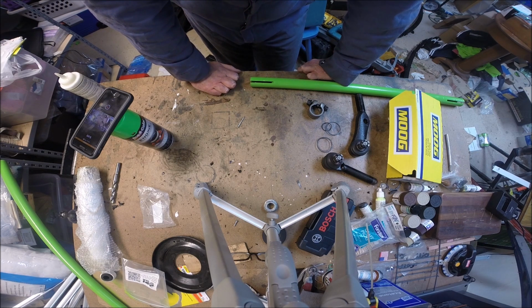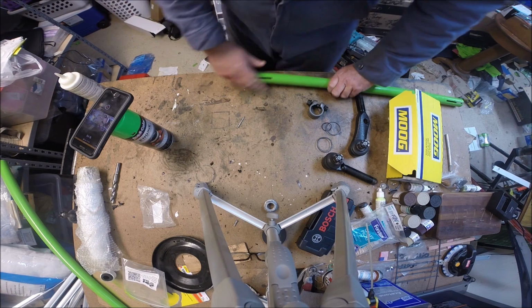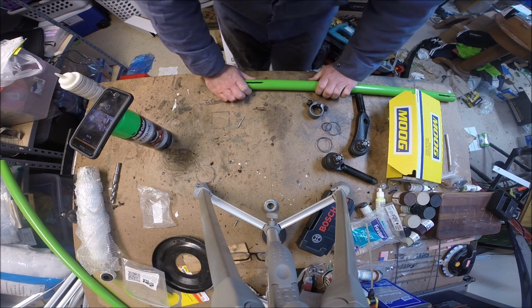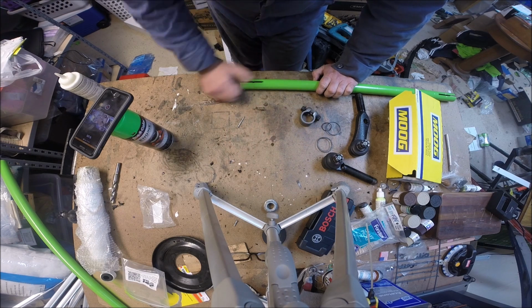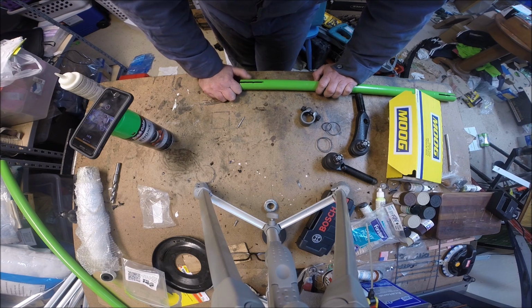If I had known at the time that you can get an Aries kit for so cheap, I would have gone with Aries. It doesn't have these slots right here. It definitely uses one-ton tie rods. It's absolutely heavy duty. It uses jam nuts instead of these clamps here. Just overall more solid. And if you did decide to go off-roading once in a while, you'd be pretty safe doing so. So of the three, I would say Aries is the best deal.